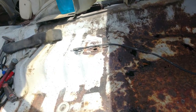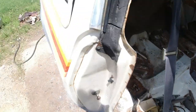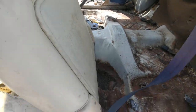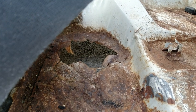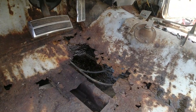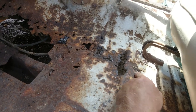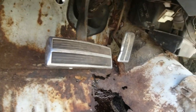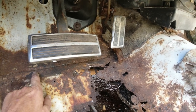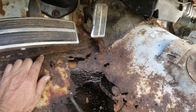The other side — the rear panel and then the back underneath the seat — that's all good on this side. This is the rear panel here that we're going to replace. On the driver's side, it's not as bad as the passenger side because the rust just goes up to here, so I can splice it in a couple inches past there. It doesn't go up into the toe panel — it goes right up to that line where the two metals meet.